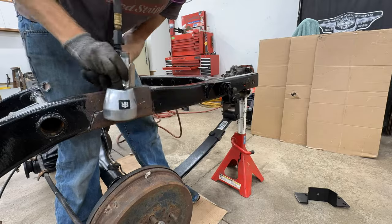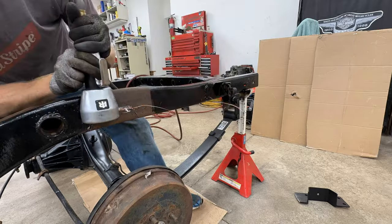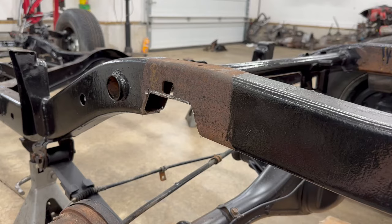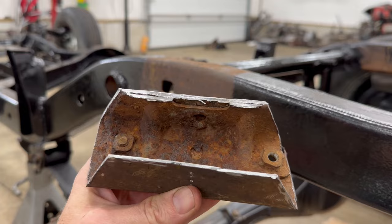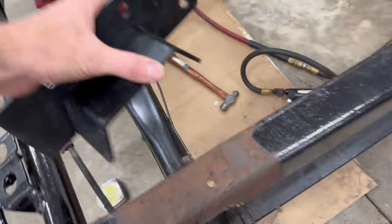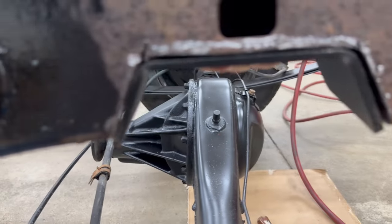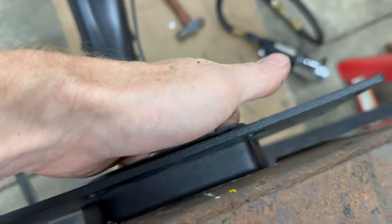For the horizontal cut across the top of the notch, the cutoff wheel was my only choice because I couldn't get it started with the sawzall blade. No wonder it took so long to cut through the outside of the frame — it's twice as thick because of this extra bracing where the bump stop attached. So now let's do a quick test fit to make sure I'm in the ballpark. Not too bad. I'm a little bit large on the back side, a little bit tight up front. I can take a little bit off the inside edge to allow this to move back a little bit.